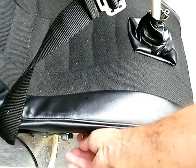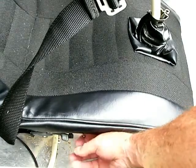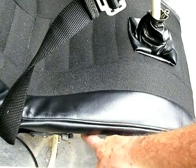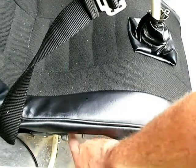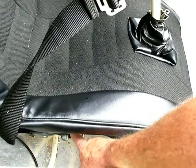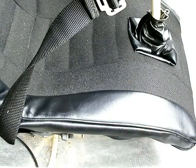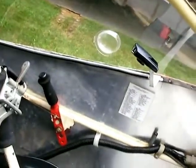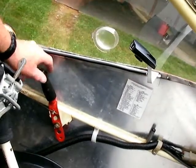This is the switch that turns on the ignition — it's really just a kill switch. When that's up, the engine's hot. If you turn that prop, it might start up on you. This switch down here is for fuel transfer, which I can tell you about later — you just pull it out and that'll cause a big red light to come on. There's the throttle lever. Always have that off when you start it.